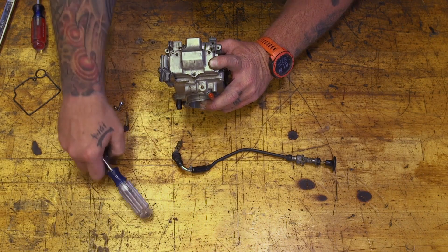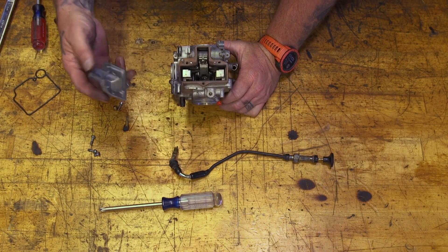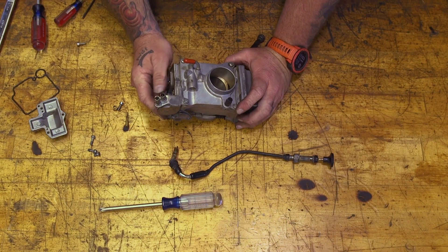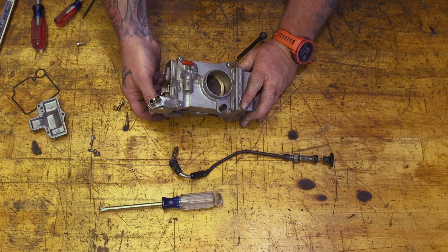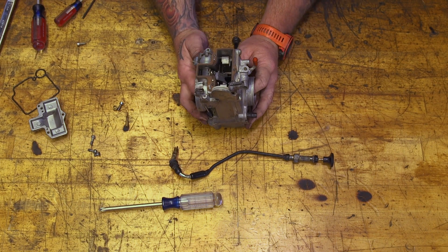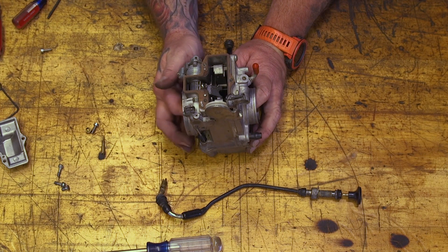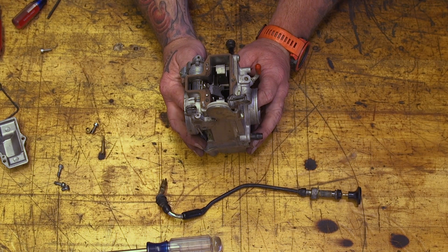We'll open up the carb — there are three Phillips screws on top. You can see when you pull on the throttle, you're lifting that slide. Something else to talk about with the slide: there's a rubber gasket on the outside of the slide, and you can hear it clacking around a little bit. That is actually a knock to a Mikuni — the pulse from the engine will cause it to rattle a little bit depending on your motor. There's an O-ring in there that will get loose and it'll just get noisier and noisier, which is one of the reasons I'm taking this apart.